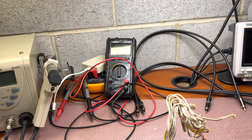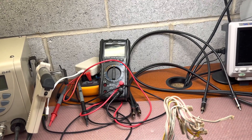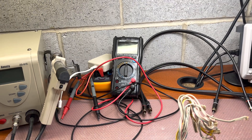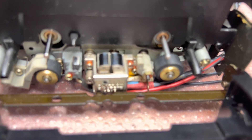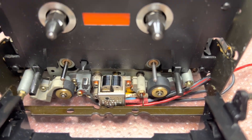I'm not sure why the Akai over time degrades with high frequency performance — I had to correct about four decibel degradation. But now it performs like the best of all decks I have; it's even better than the Nakamichi Dragon. And if you see with the naked eye, I was not even able to see any residue — it was so incredibly small.